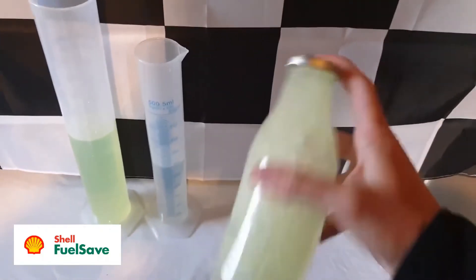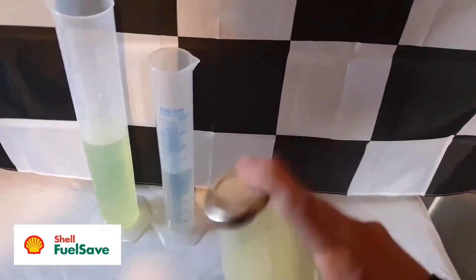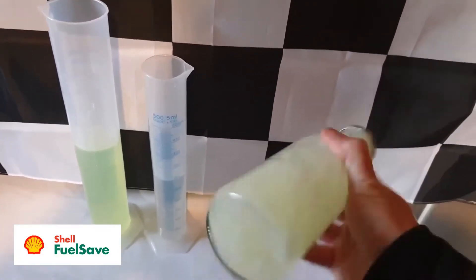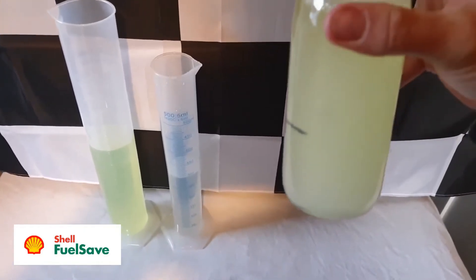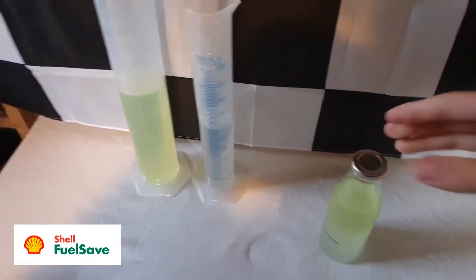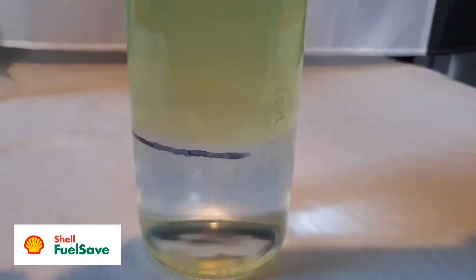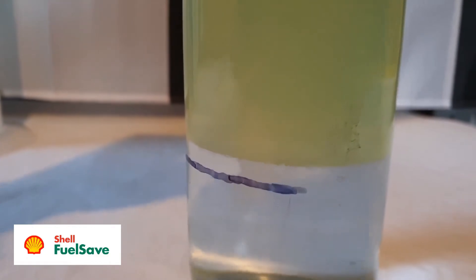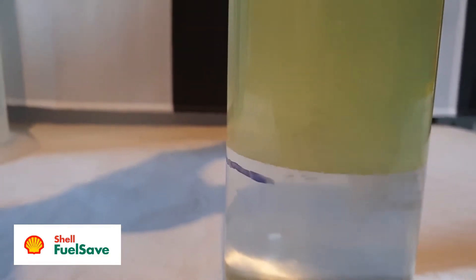So let's make sure we give this a proper shake up. Now this is properly mixed — you cannot see any separation of the petrol and water, but it's immediately producing a froth, and in less than a minute you can see the instant results of the water line now higher than it was because the ethanol has moved into it.